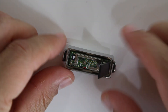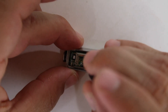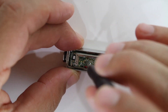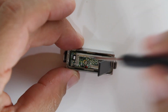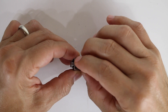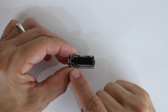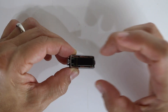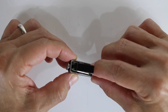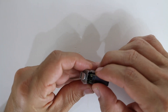Now there's a little screw under there so we're gonna have to expose that screw. We're slowly taking the screw off. Now that we got this off, it's going to be able to wiggle out. What you want to do is slowly just push it down because there are two little ridges that slide into place, so you kind of just push it down. Try not to pull it from the LCD screen — just slowly pull it down.